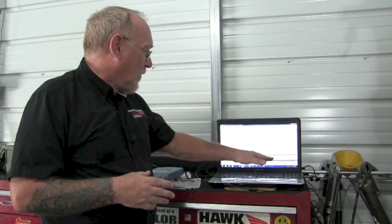The current scale is set from minus 20 up to 600 amps — and before you start freaking out, there's a reason it's so high. We'll talk about that in more detail in a moment. The time divisions I set up are 500 milliseconds per division, 10 divisions on the screen — that's a total of a five-second capture. If you want to perform the full three-minute test, you can adjust those time divisions accordingly. On the PICO and other lab-based scopes, I can put it all on one screen and zoom in on sections I'm interested in. Follow the instructions with your scope, practice with it, and you'll get very comfortable setting all these parameters very quickly.